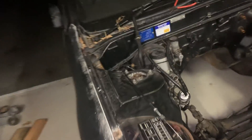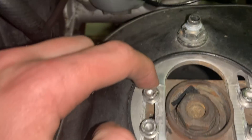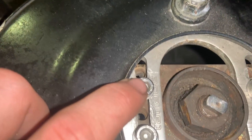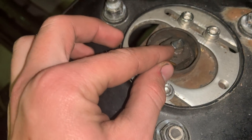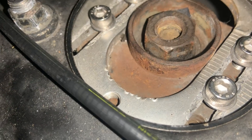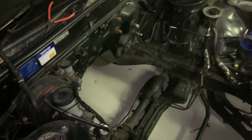Something I haven't noticed before - on the top hat on the shock here, you can see it's cracked just through there on both sides. And on the other side, you've got the same thing, just not quite as bad, but it's definitely on its way to cracking. Also, that's how the bolt's supposed to look. But on the one over here, you've got bugger all thread actually on the nut. So these front adjustables are pretty much junk.